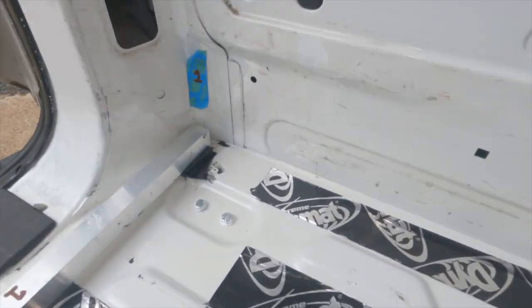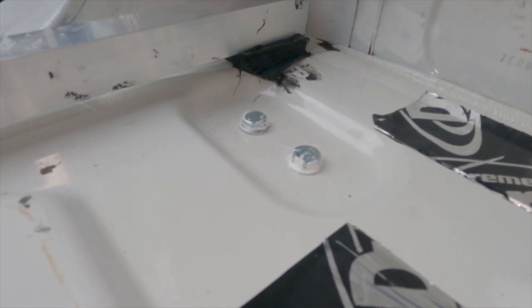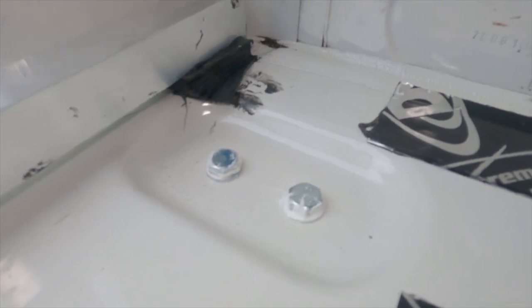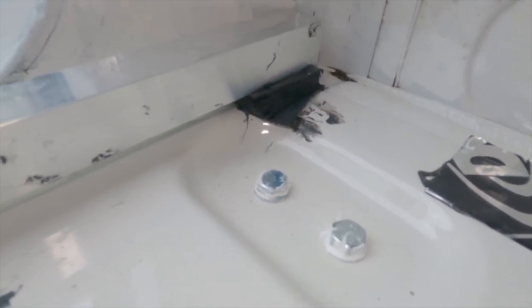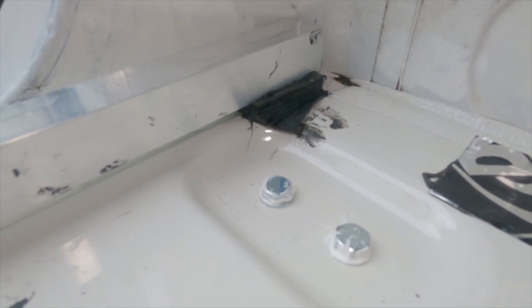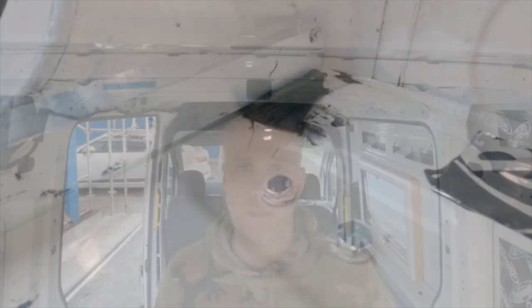Fast forward — I've done a few things with the floor. I've filled up some of the holes that were part of the original floor — siliconed them and put some new bolts in. I've also put packers in on the edges of the aluminium just to stop the flex right on the extremities where there's no ridge holding them up.